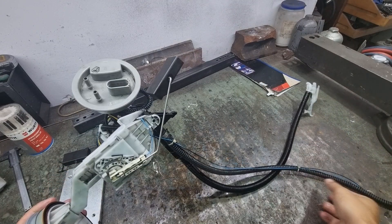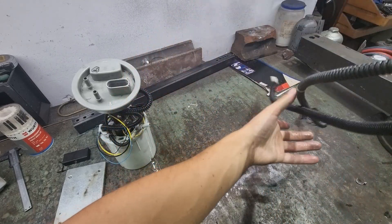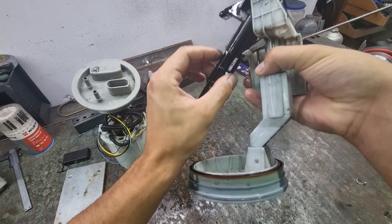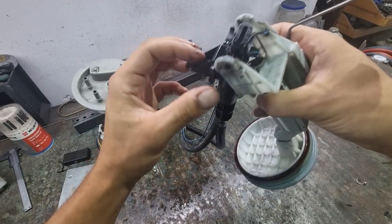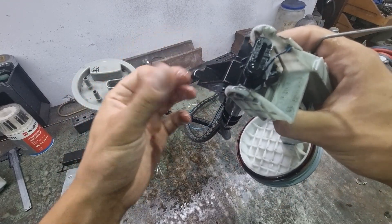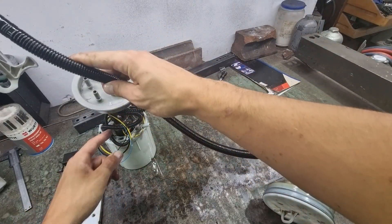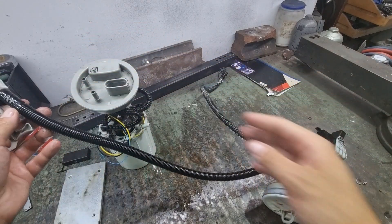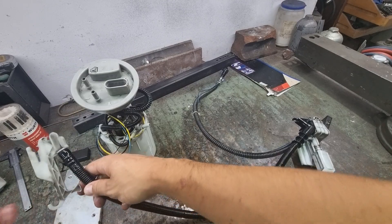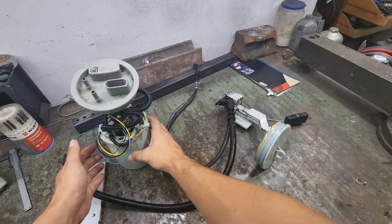This connects here, then fuel travels through here. There is also an ejector — fuel goes around, makes a vacuum, a negative pressure, and sucks the rest of the left tank fuel. It sucks fuel from the left tank through here, then fuel from this pump's small hose and fuel from the left tank is transferred into the right section of the tank. It's a really complicated system, not quite easy to understand. This is the pump from the MK4 PD engine — specifically from the PD-130.